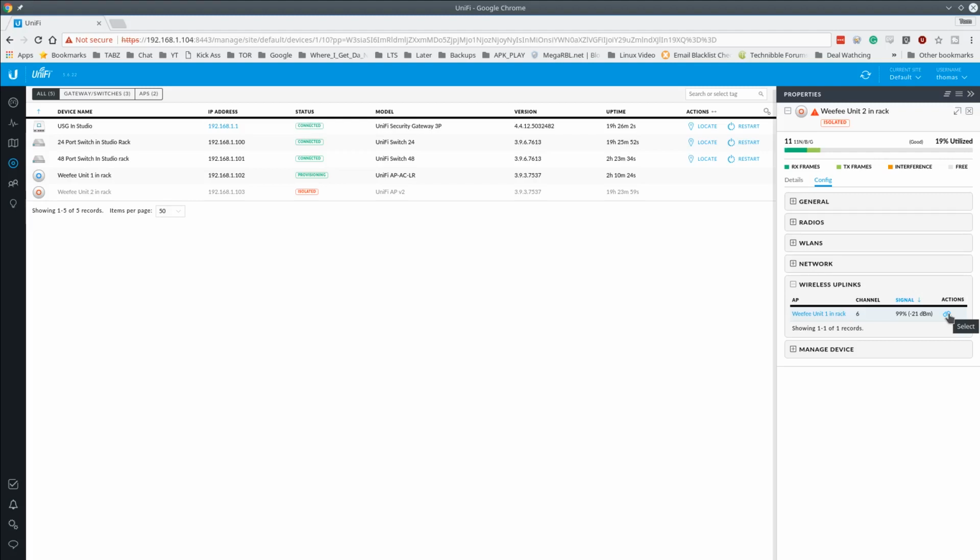I've actually done very little testing with this because generally I'm not the biggest fan of mesh networks. I've worked with them a few times and we've been called in to replace them because I've never seen one that works as seamlessly as I think it should, and generally hardline to each one. It's just way faster and less prone to problems. Especially because most of these networks that we put in have a lot of users, so handing things off from mesh to mesh becomes kind of tricky.